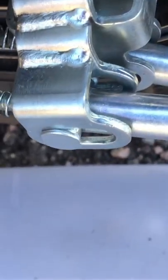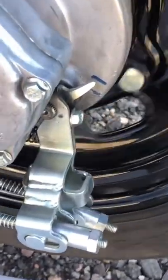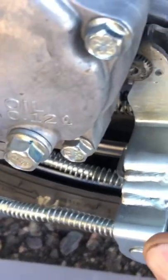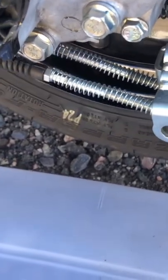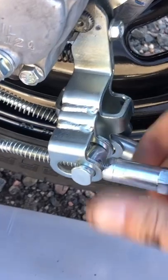On my bike I'm not using the parking brake or the linked brake system. I only hooked this up just to give a little bit more of a demonstration. As you're adjusting the brakes to begin with, you want to make sure the wheels are off the ground and they can roll freely. You simply adjust these by hand — it's a little hard to turn just by hand without a wrench, but if you push back on this lever while you adjust it, it works well. This one is loose because the parking brake cable is not attached right now.